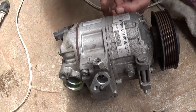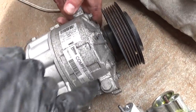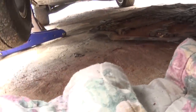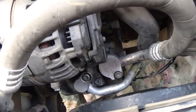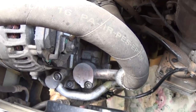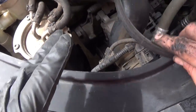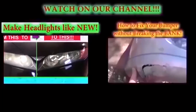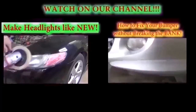This is the replacement one. What you need to do now, you just put it back together in reverse order that we took it apart. But you need to make sure that you have these two bolts in before you install it on the car, because otherwise you won't be able to put the bolts in. The third bolt you can do it later. You just put it where it's supposed to be. We got everything tied up now — just in reverse order. You install it, get the three bolts tightened, and you install the hoses. All we have left is to do the serpentine belt. We have a video on how to install it if you have trouble with that. We also have a video on how to recharge the AC system — find it on our channel or under the playlist. Thank you for watching. Don't forget to subscribe for one new video every day.